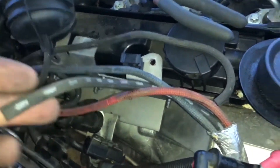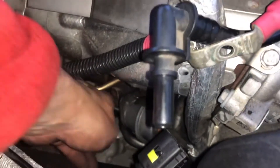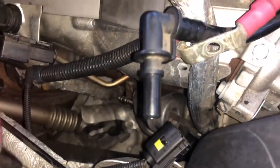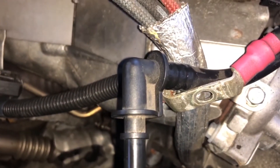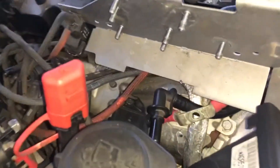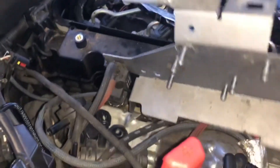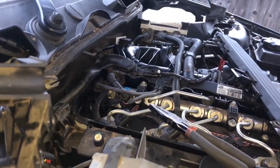This vacuum pipe here is the one that goes down to this actuator. You can see that this actuator moves, but when I pull vacuum on it I can't seem to get it to work. I had to remove the diverter valves off of there, and then there were some cables stuck to the back, and now it's just that last piece which I need to get off.